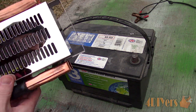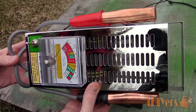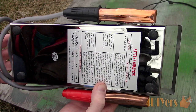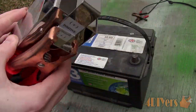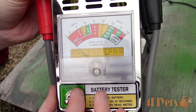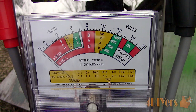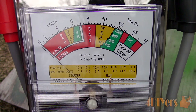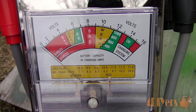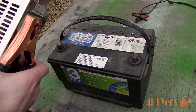Next is using an analog tester. This has an element inside — when a load is placed on the battery, the element heats up and you can sometimes feel the heat through the vents in the case. This tester can also be used to test the vehicle's charging and starting system, however it may not be as user-friendly as the digital version, and you can see it's quite a bit bigger. The switch is used to activate the test — hold it for 10 seconds and monitor the gauge. With some analog gauges they also need to be zeroed, and there is usually an adjustment for this.